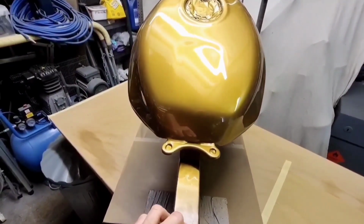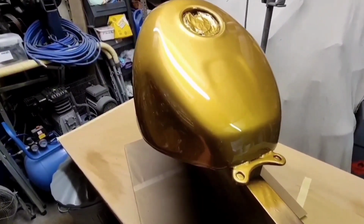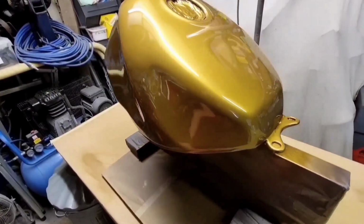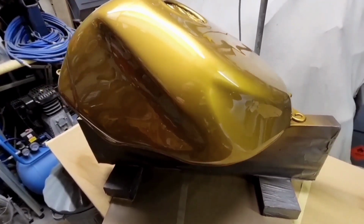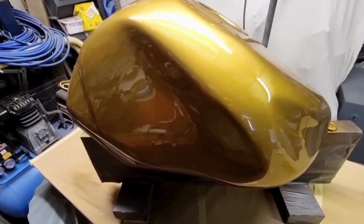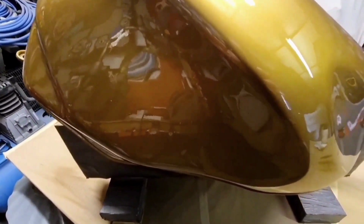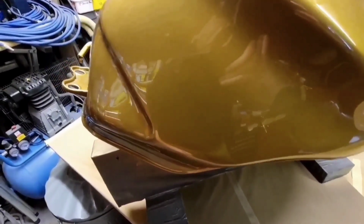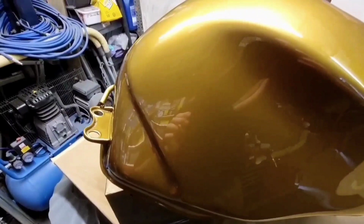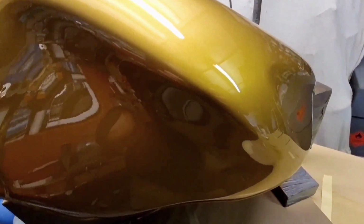So if you look at this, it's a pretty flat finish for a 1.0. It's a U-Pol clear coat. Throughout this video it's a U-Pol clear coat. It doesn't help the guns whatsoever. It doesn't flow particularly well. So if you can get a pretty good finish with the U-Pol clear coat, guaranteed is probably the wrong word, but you're certainly looking at being able to get a better finish with a better quality clear coat, because it just flows out better.